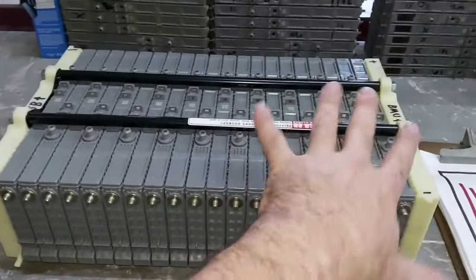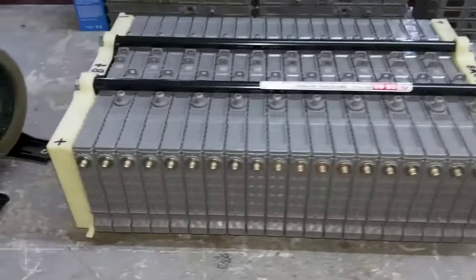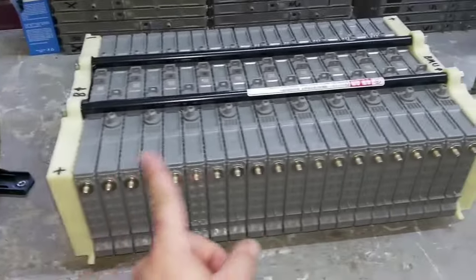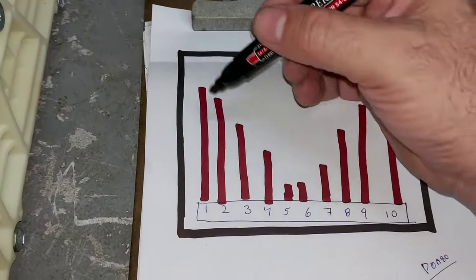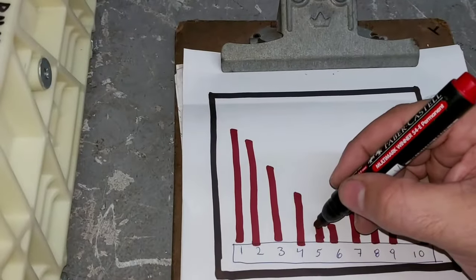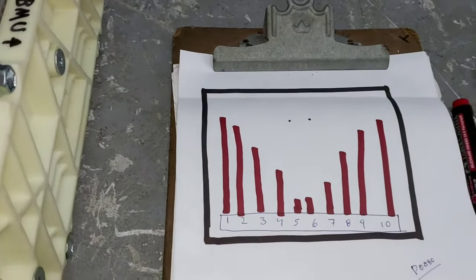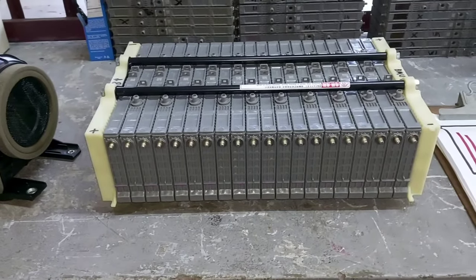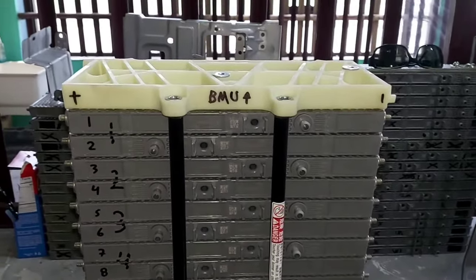To avoid these issues: take out the whole frame, clean the individual modules, rotate them, put it back together, and install new connecting lugs. Then we cycle the batteries using the Prolong machine — a collective charger and discharger. If by chance any cells are out of balance, this machine restores them back to proper balance. That's basically what servicing this nickel metal hydride high voltage battery involves.